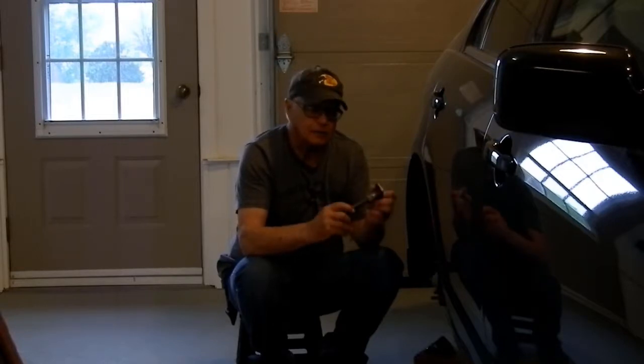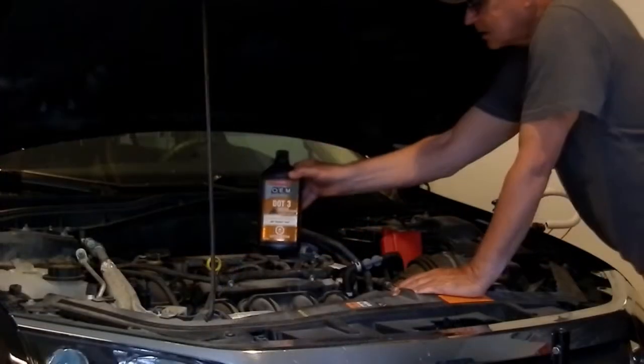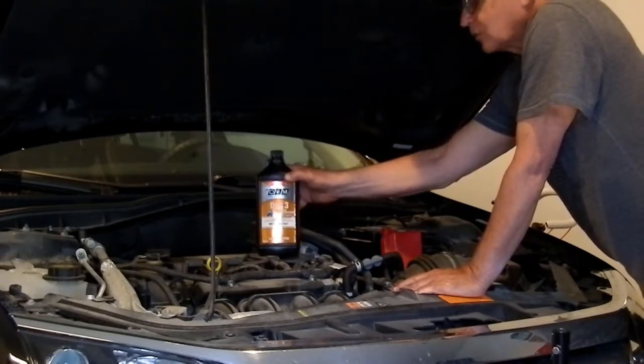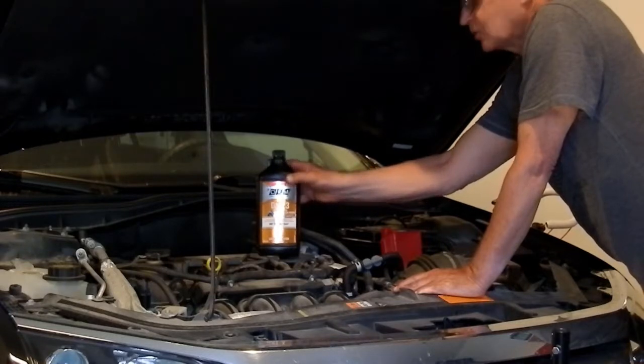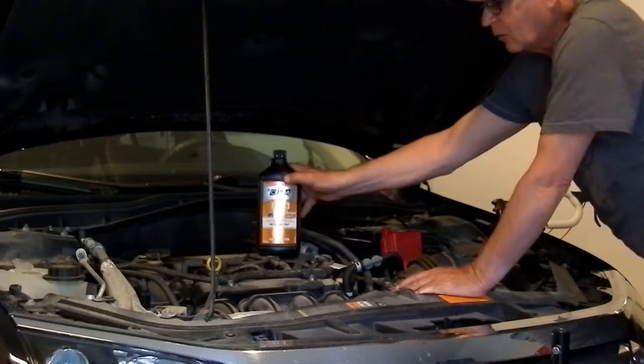I could probably rewind the piston back in with this tool nice and quick. I just take my time a little bit, push it back in slowly and let the brake fluid go back. ALLDATA doesn't make any mention of taking any precautions with reverse flow at all. So we can afford to be generous with the brake fluid flush. Brake fluid is sold by the liter, and once you break open the seal in the container, you can't store the material. So you may as well consume all or most of it when you're doing this work.